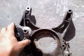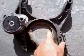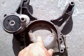One interesting thing that we did was we realized we didn't really have to take the alternator and all that jazz off just to change the oil seal on the left cam sprocket, or underneath the left cam sprocket, but because it wasn't reachable, the right side was fairly easy, so we found out we had to take all this here off. This is the alternator bracket, and there's a plastic plate that goes in here. It comes straight across. The actual spindle is in here.